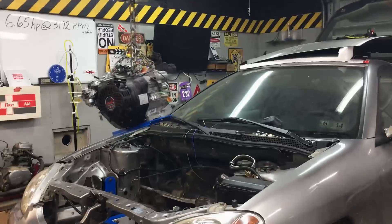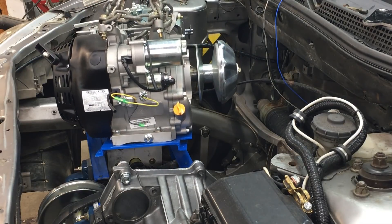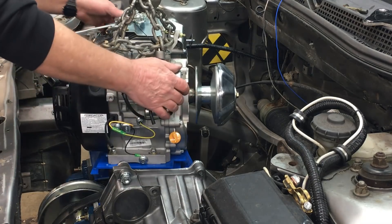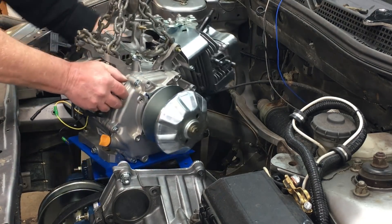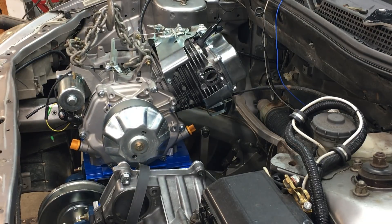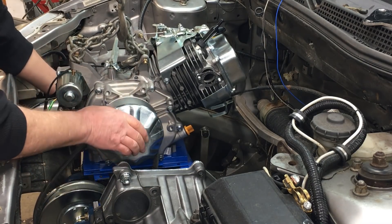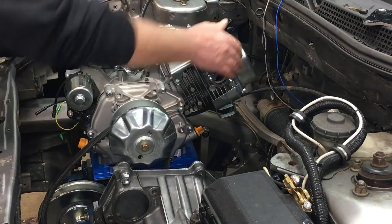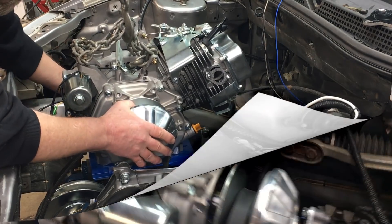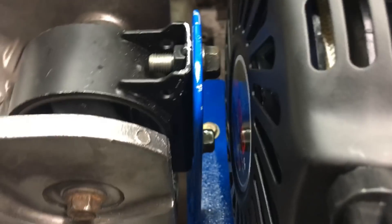It's time to drop the big block into the Honda. This engine's equipped with electric start and it also has an alternator of sorts — we'll make all that stuff work, making our street-legal go-kart the ultimate in luxury, at least for a go-kart. The idea behind the motor mounting system is to allow the bigger 420cc engine and the smaller 212cc engine to utilize the same engine cradle. The engine's bolted down, the crankcase is filled with oil, and there's three-quarters of an inch clearance between the engine and the motor mount. Tight fit, but we made it work.